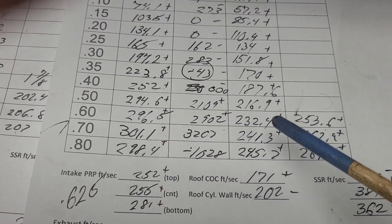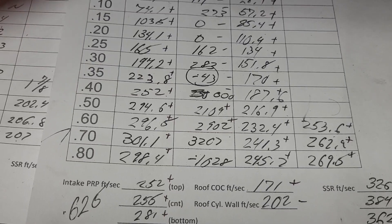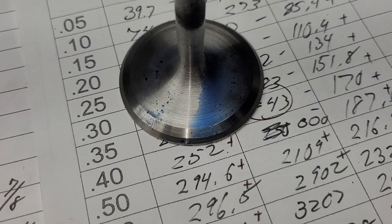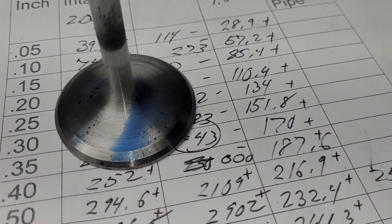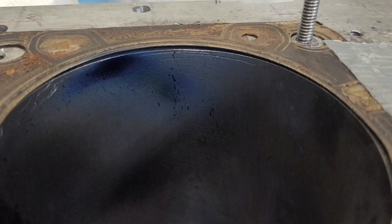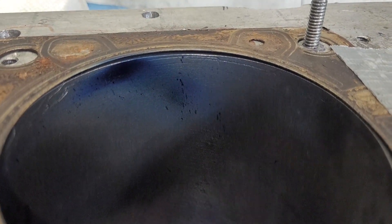Calculate the exhaust-to-intake ratio — I'm not big on exhaust-to-intake ratio stuff, but it looks really good. I forgot to mention the liquid flow on the valve — it looks pretty good. And we're going to show you the bore. The bore looks pretty good; I think I did that at 625. On the flow bench, the only gasket we had available to quickly use was a 318 gasket — an OE 318 head gasket from 1969. It's 3.91 and it's actually a little odd shape; it's not even a perfect circle. Mopar guys know what I'm talking about.